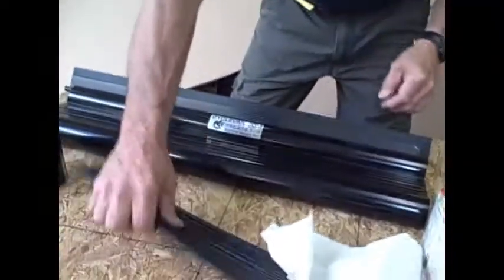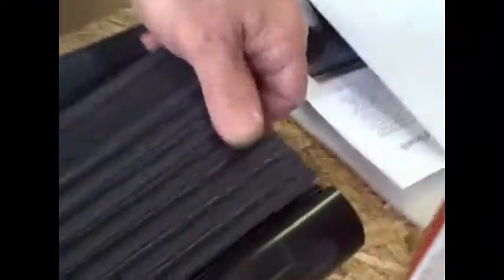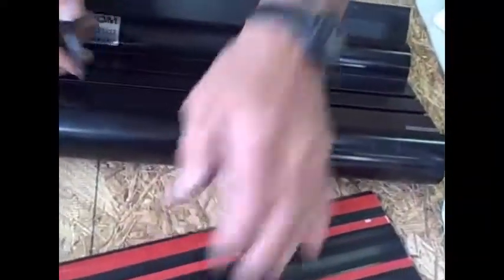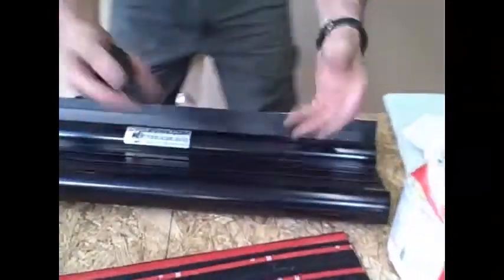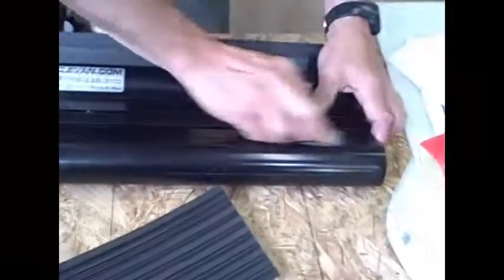The next thing we're going to do is look and see where the adhesive strips are. We're installing this such that the ribbed section is going to be facing outboard — this one's smooth, this one's got little ribs in it. Before we put that down, we're going to take the sandpaper and sand the surface and rough it up so this adhesive can bite in. This will give you a better bond than you had initially. You're only going to stay within the area where the step tread goes — scuff it with the supplied sandpaper, making sure any little piece of adhesive is removed.